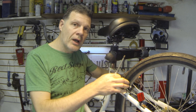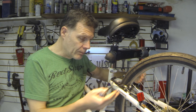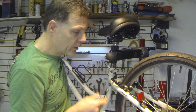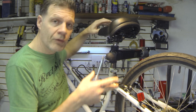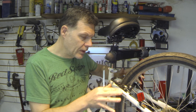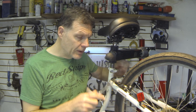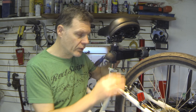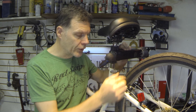There's one screw on each side. If you make them both really tight, your lever feel is going to be a little stiffer. If you loosen them both up, the lever will be easier to pull but it may not open up fully, so you have to balance it. You just adjust the screws on one side and the other, and you'll be able to center the brakes so they're not rubbing on your rims.